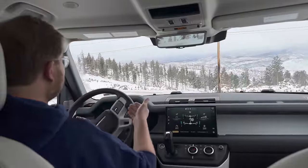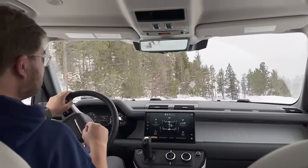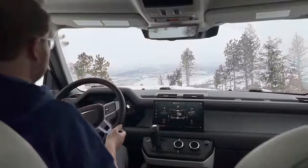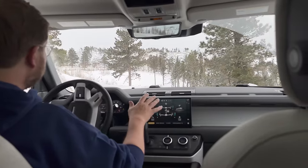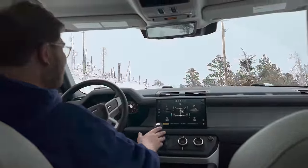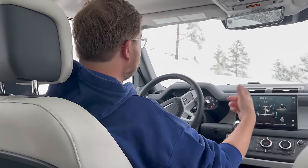There's just a little bit more that you have to do when driving this vehicle in the snow than presumably the Rivian. I'm working the gear selector, thinking about where my revs are, needing to put my foot down earlier. And it's a question of where the power is actually going — in grass/gravel/snow I don't have the center diff locked at a fixed 50/50. It definitely goes rear first, then locks up. There are three or four stages of center diff locking, all the way to 100% lock, and it's somewhat electronic in how it goes about its business. The nice thing about terrain response is when you're in grass/gravel/snow it really stays out of your way. We'll flip around and run the Rivian on the same loop, then find some deep snow and also address batteries and range in snow versus a combustion vehicle.